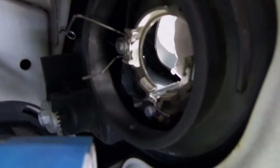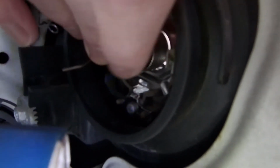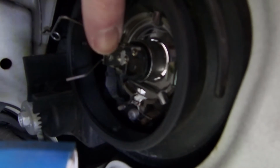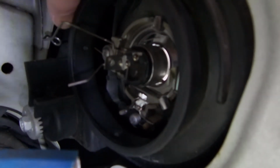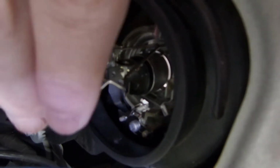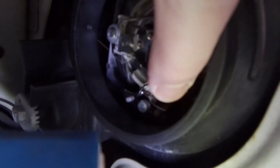All right, so we're back down here. It plugs in the single spot on top, the single clip, and the plug will have the extra one on the top, two on the sides. Now we're going to bring this in. Trying to keep it so you can see it. Push it in, down, then up so it catches that clip. The bulb is now in and solid.